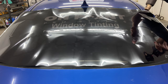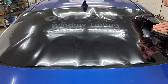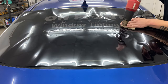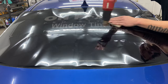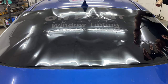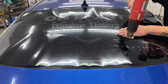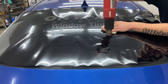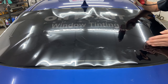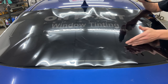I start from the outside and work my way to the middle. Your outside corners tend to be your bigger bunches, so it's easier to kind of shrink more of the film and push it just a little bit toward the middle — not too much, but you can push it gently toward the middle and kind of spread the love. Like here on the outside, I'm shrinking this down, but I'm also pushing a little that way to spread the film out some and shrink it a little bit more evenly. You can see these lines like this — you can see where it's bunched up, and you can see the tops have kind of flattened out. That's where the film's pulling in and it's actually shrinking together. When you see those lines like that, that means that film has shrunk and it's tightened up.